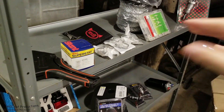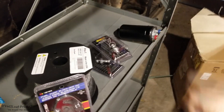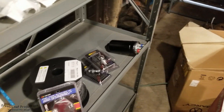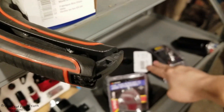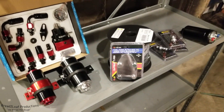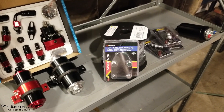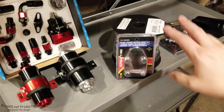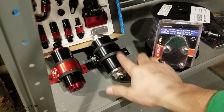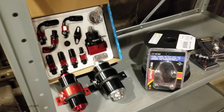So the main parts of the system: obviously we have a high pressure fuel pump right here, and that's going to be delivering our fuel at 43 psi to the fuel rails. We have new fuel lines, a fuel pump block-off plate because the ambulance right now has a mechanical fuel pump bolted to the engine — the OEM carburetor fuel delivery system. We're going to remove that and block it off, and then we have our post and pre-filters and a fuel pressure regulator.